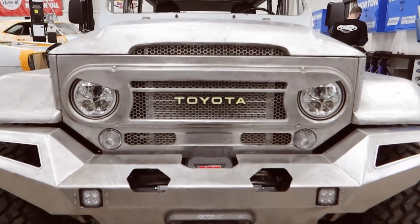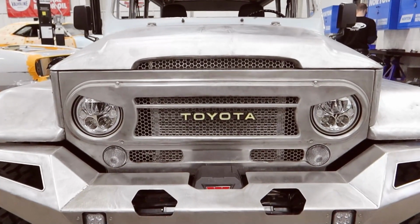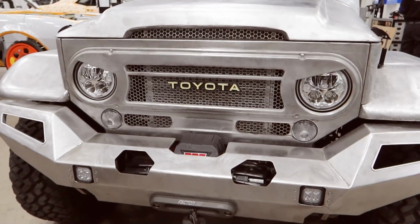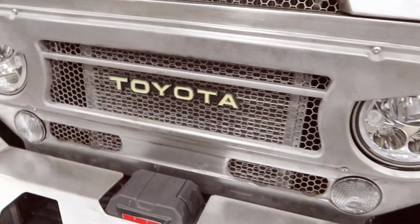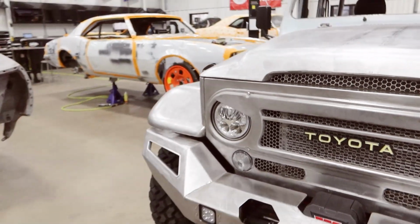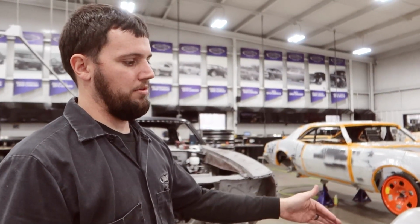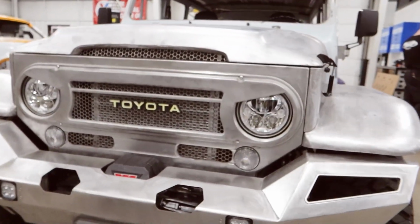That is crazy. And that's just to package the drivetrain. Yep, package the drivetrain and fit the track width and the wheelbase of the Lexus chassis, and keep the proportion right. They changed the front snout of the frame to accommodate it and add the sway bar. Yeah, we had to build a full, basically, core support to mount the radiator. Had to build basically a one-off sway bar assembly because the Lexus wouldn't fit with the winch.